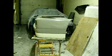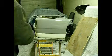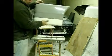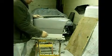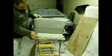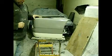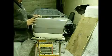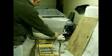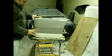We've left our PU sealer overnight and now they're bonded on, and these are on really well. They're really nice and strong and not going anywhere. What I did was took the tape off, run a Stanley blade down on this edge, just picked away the waste. Now this is nice and neat and tidy, this edge. Now we could have quite happily painted these spats, bonded them on this way, and that would have been fine.